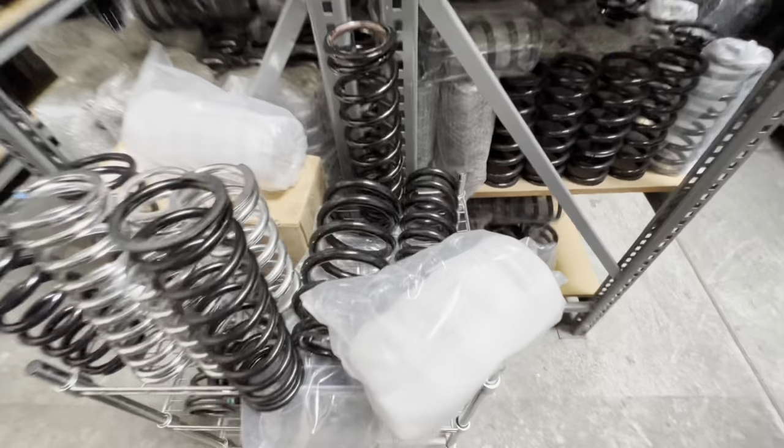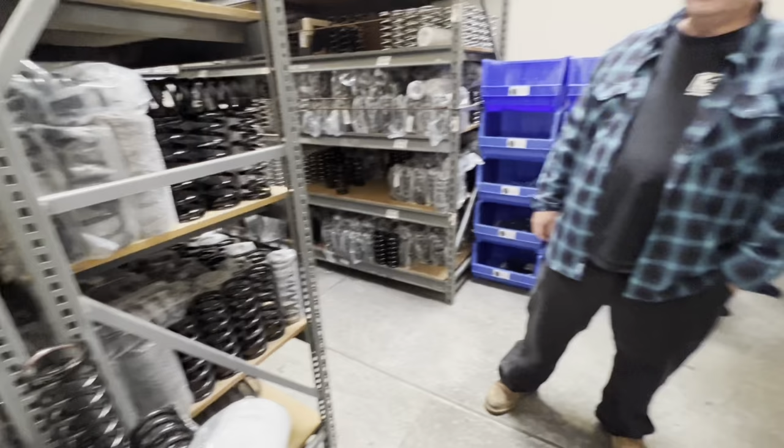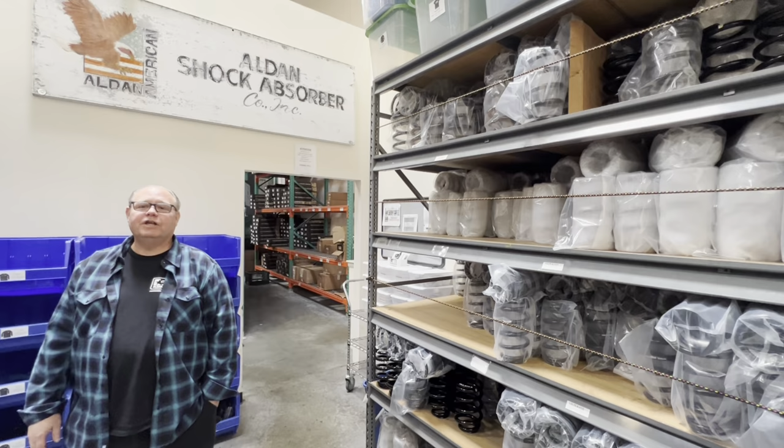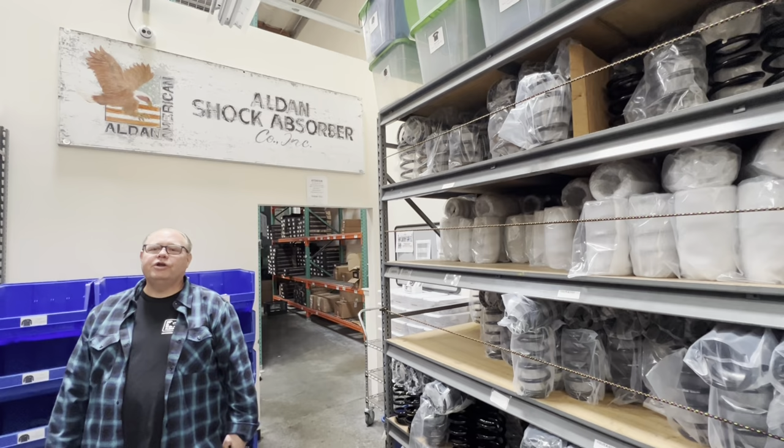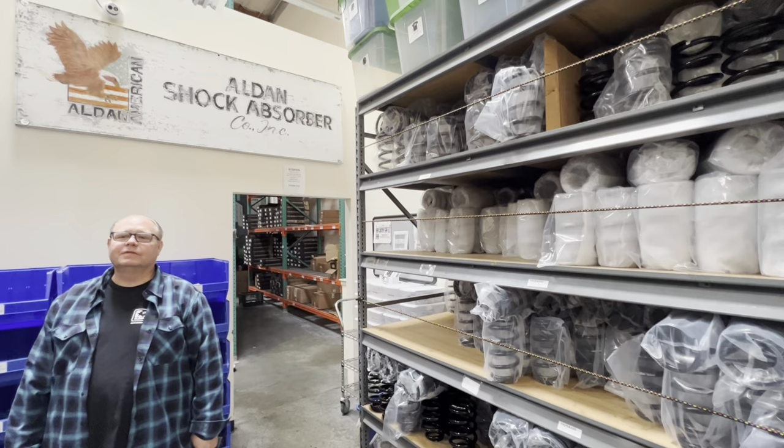If you are a number counter, of which I am not. Right, Gary? I am not either. Okay, cool. And then if you've got straight coilovers, there they are. Long coilovers, there they are. Is that called a progressive spring? Well, it's technically not a progressive. It is a linear spring. But the coilovers, we do the 2.5 inch. We do them from a 6 inch all the way up to 12 inch in length. And then spring rates, the lowest spring rate we offer is 100, and then we go all the way up to 800. That's a lot of springs.